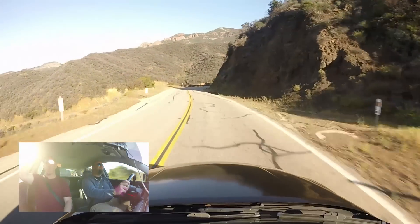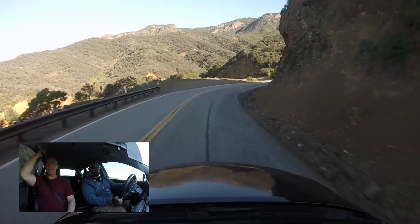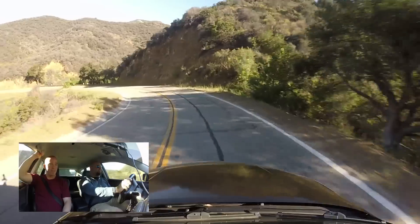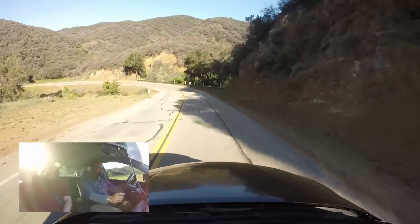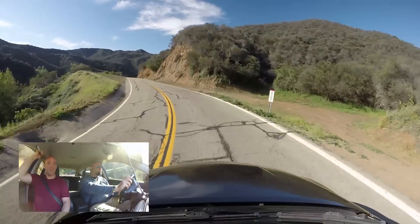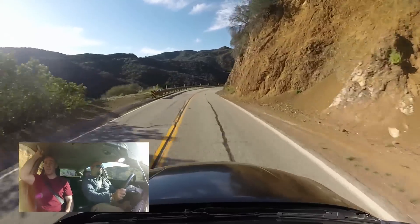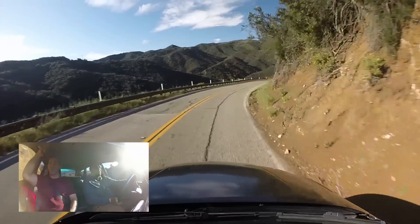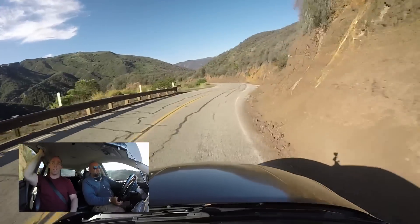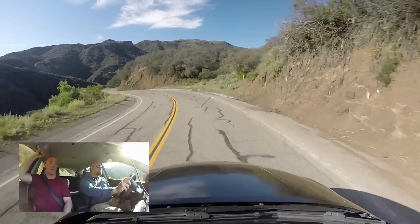Well, this is a fast car, man. It's stock-looking so it's pretty sleepy. Did you even debadge it? No, it's still got the badges. Because if you debadge one of these, especially a first-gen, it can be super sleepy. It's got a tapered boost curve too — it hits full waste gate around 18 psi and builds up to 26 by redline, by RPM not by speed.